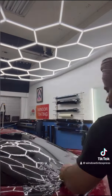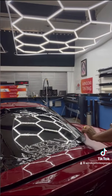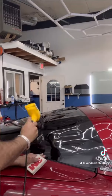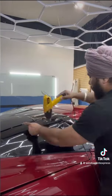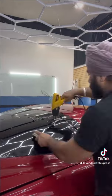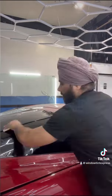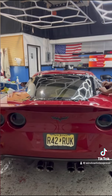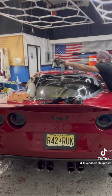You have to pull the film, make a relief cut, pull the film, and heat it really good. Once you pull the film it's going to shrink, but you have to take your time — you cannot rush into this. That's why my video is not that great, because I focused and concentrated on shrinking the film. I was really happy because I did it in the first try.